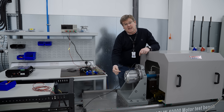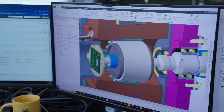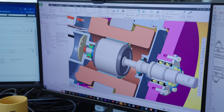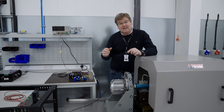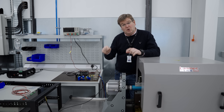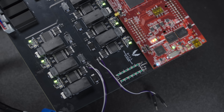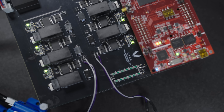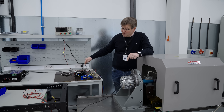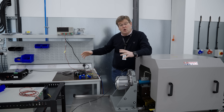One problem was with the rotor position sensor. We've designed a new position sensor, integrated that into the MGU, and manufactured all of the new components to allow us to validate that. We've subsequently completed all of the testing with the new position sensor. That allowed the MGU to validate the performance of the power management unit, calibrate all of the internal algorithms in the control system, and more recently we've been hooking this up to an electrical load to get the system working under load.